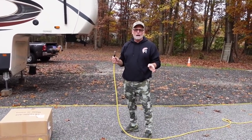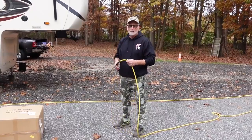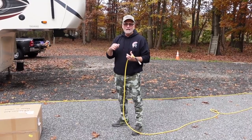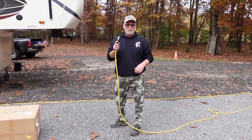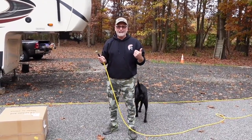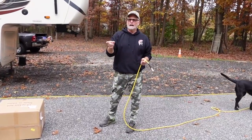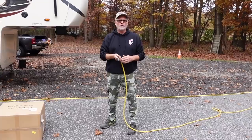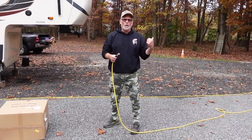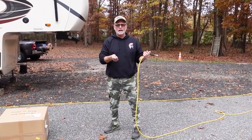I've drained the water out of the hot water heater already, which I'll have Terry show you in a minute. Then I'm going to hook my compressor up to a pressure-fitted line on the other side. That will pump air into the water lines. Then I'm going to run around like a scalded cat, and I like to bring up cats because I've got four so far. I'll slowly go from the kitchen sink to the bathroom sink to the shower to the washer dryer hookup in the front, and let the water drain out until air comes out.